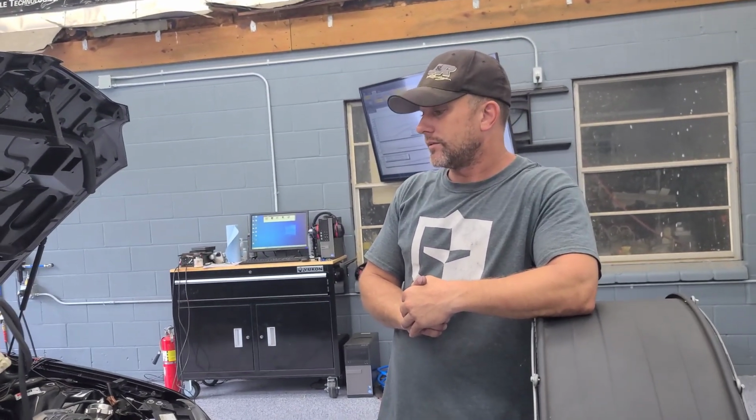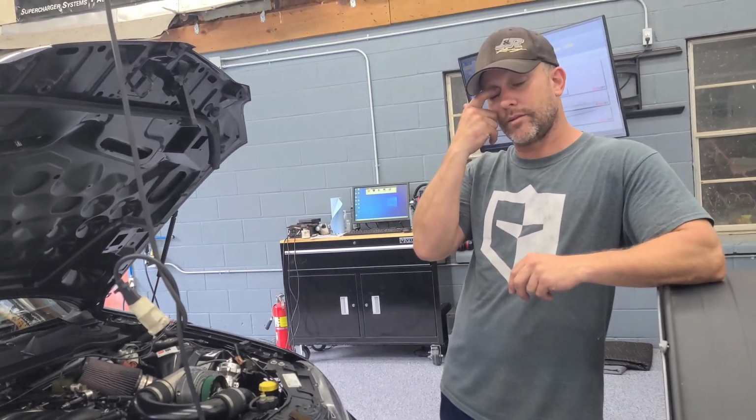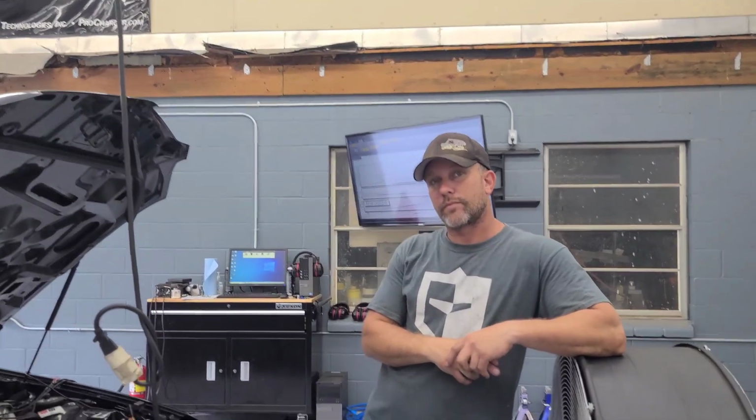Oh, actually, he is. We're going to try, since he does have an SS, to put the new DSX pump on his. That's right. Because we had an SS in here that made 850 with the 2650, stock pump and a 2650. I'm sorry, stock pump and a new DSX, and it held. It had 70 plus pounds of fuel pressure the whole run. So it might be worth a shot. We're going to try it because it's cheap. I mean, it's $120-$130. We just got to say, Juan, when you come in here, I hope you're okay with towing your car back home.